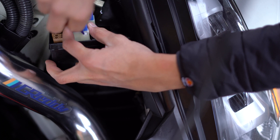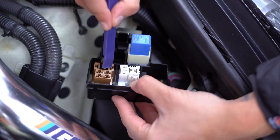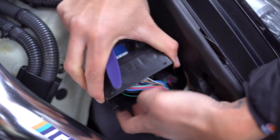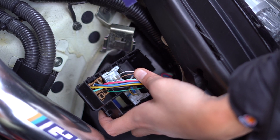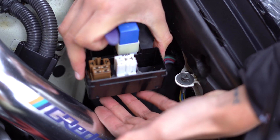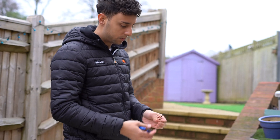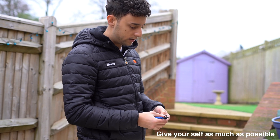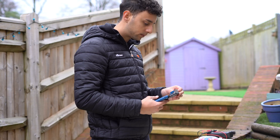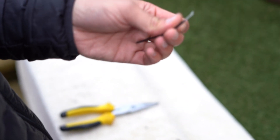Take the top cap off and remove the DRL relay. Just like before we want to connect that terminal to that terminal, which on the other side is the green wire and the browny-beige wire in the middle. It will achieve the same job but look nicer and be more reliable than just having a wire bridging across the two. Take a piece of wire about 10 centimeters long and cut it in half. Then take your wire snippers and snip the ends to strip them.